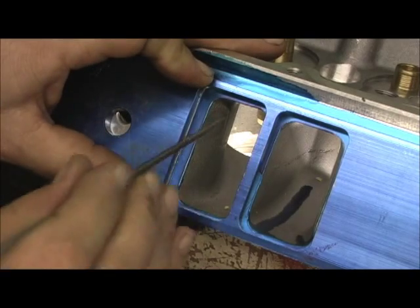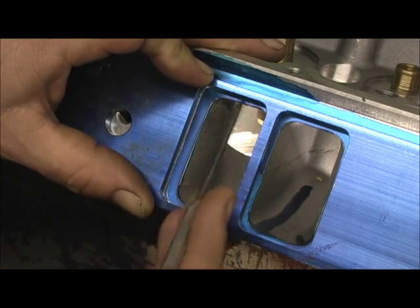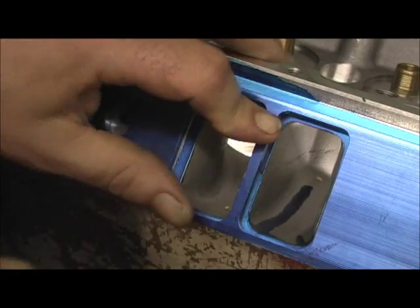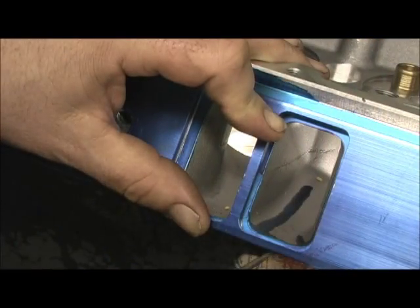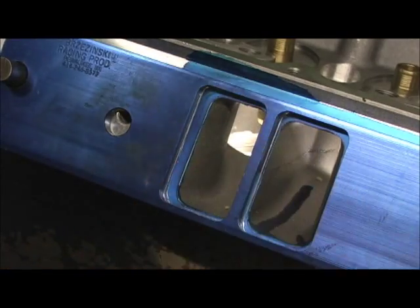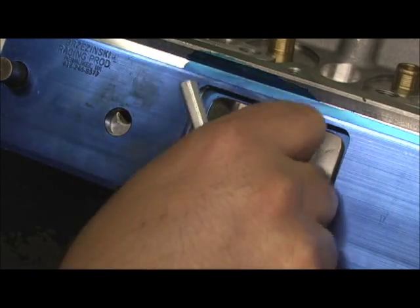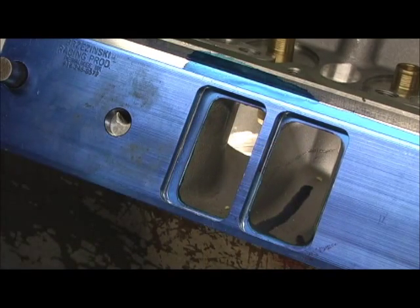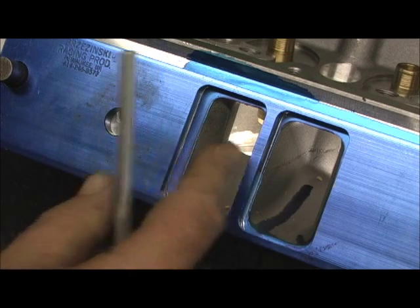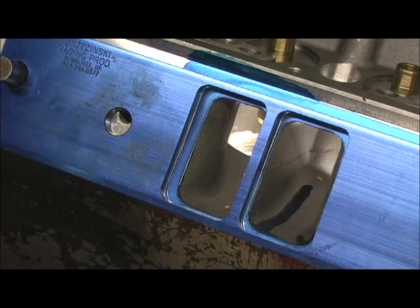It just makes it so much easier because you can put pressure on it, but it's on the bigger side. I just go around it and I always port inside the lines anyway, so that gives it a few extra thousandths. Right here on this side, as you remember, where the cylinder head isn't perfectly laid out — it's diving in probably about 10 or 15 thousandths inside the wall. But that's okay, because the intake manifold is going to be smaller now that we've scribed to this piece.